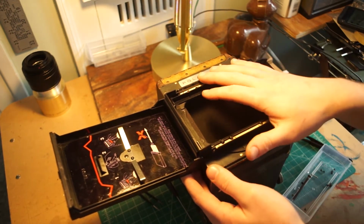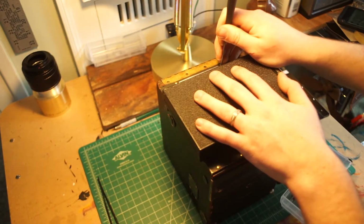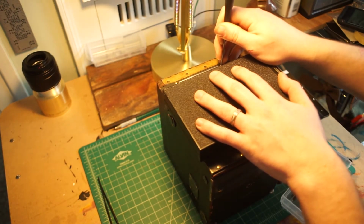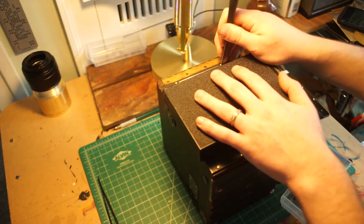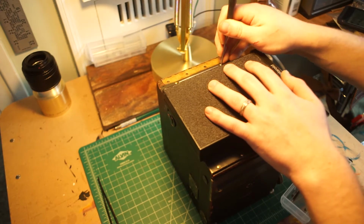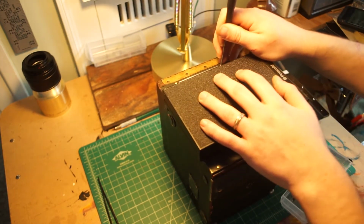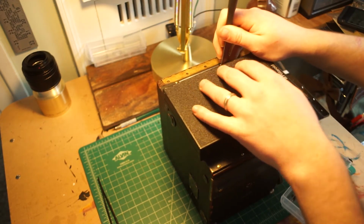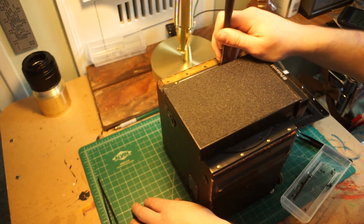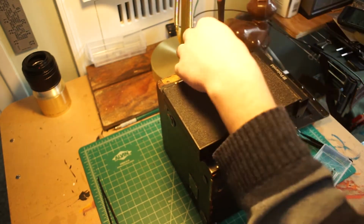We're going to go ahead and remove them, and I'll point to the part where those screws are. I'd like to remind everyone that even if the wood screws are hand cut or machine cut, they all have thread variances and usually have to go back into the same holes that they came out of, just to ensure that we're not going to strip the screws out through the life of this camera and modifying and removing the back. So to keep things straight, we're going to arrange all the screws in just a geometric pattern over here to keep them all corresponding with the shape of the back.